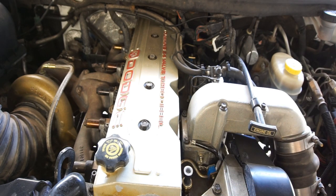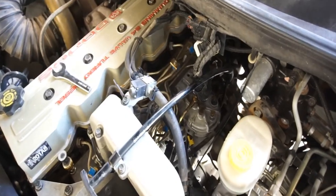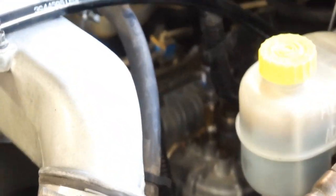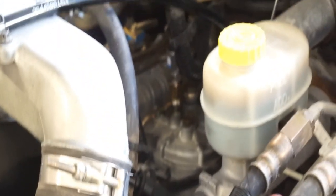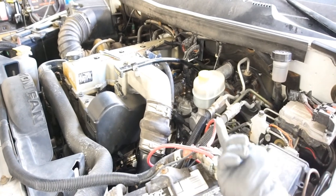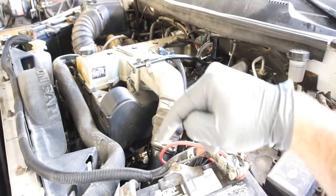So that's probably it. That's all I'm gonna go on top of the fuel bowl. I don't know if you can see it in there. That's the sensor right where my hand is. Right there. That was the only banjo that it fit. So I guess that's fine, because it's coming... let me back up real quick. Fuel's coming out, going into the filter, and then coming up the filtration system and out. So you're gonna have the same PSI here as you would down here because it's coming out.